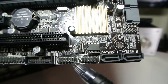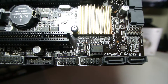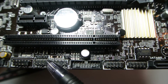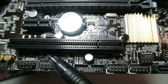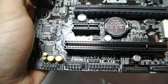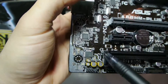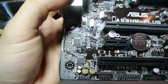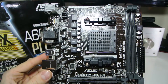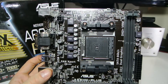Starting from the bottom edge: we have the speaker header and all your front panel power connectors. There are two more SATA ports here giving us four SATA 6GB/s total. Then down here we have two USB 2.0 headers adding another four USB ports — giving us eight USB 2.0s in total — plus a USB 3.0 header. Over here is the TPM header and what I believe is the S/PDIF digital audio output. Then there's a COM port for old serial devices, and finally the HD audio header with the audio shielding that emits light.